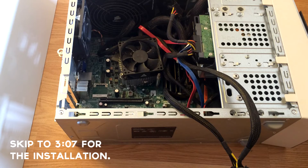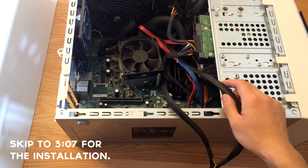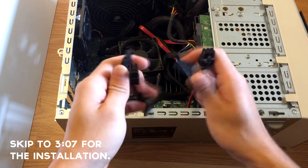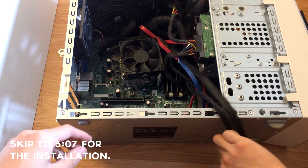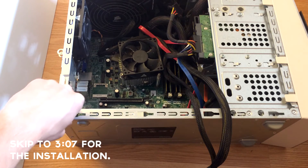I cleaned up my cables a little bit. One thing I should add — if you have a mid tower ATX case and you plan on upgrading your power supply or just changing it, please do yourself a favor and get a modular power supply. Because as you can see, this is non-modular and the cables run everywhere — it's ridiculous. But I managed to pull out the two PCI Express pin connectors. You want to get those out first just in case they get trapped somewhere around the card. Leave a large area exposed for your card — or at least for the 780, it's a huge card.